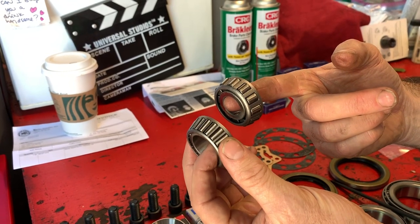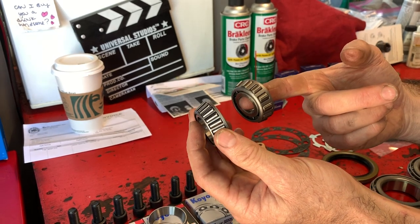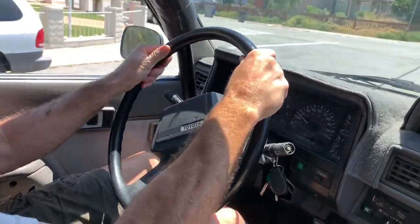I'm going to change out the 17 millimeter trunnion bearings for larger 25 millimeter bearings and the associated parts. The reason I'm doing this is because when I took my truck in for an alignment, the alignment was toed out. When they brought the toe in pretty much perfectly straight, I got this gnarly death wobble. I had to make a U-turn, go back to the shop, and they toed it back out, then it drove fine. Research suggests it could be something wrong with the front end — knuckle bearing preloads off, loose wheel bearings, or bad tie rods — so I'm doing this repair to eliminate those possibilities.